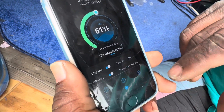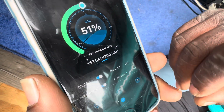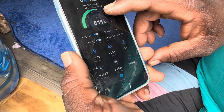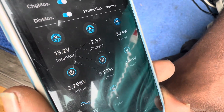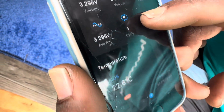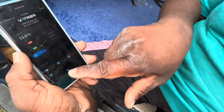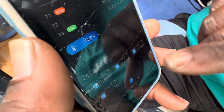It's showing 51 percent remaining capacity — that's 153 amp hours — so I need to get a full charge. The current draw right now is 2.3 amps. I like this because sometimes we're running the AC or the refrigerator and we're nowhere near the battery in the van. This is already built in; it shows the temperature and shows each cell as well — 3.295 volts per cell. Pretty cool.